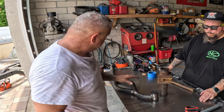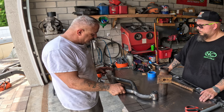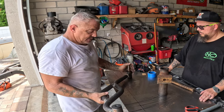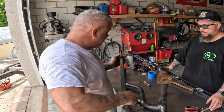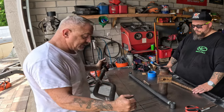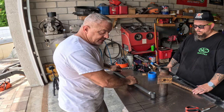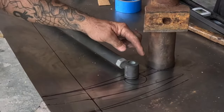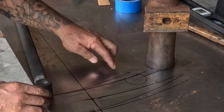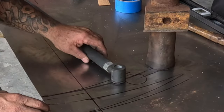We're going to shorten this bar — I want to say four inches, three and a half inches. I'm just going to cut it off here at the very end and re-tap some threads. To give you an idea, this link bar is basically four inches shorter. So we're going to put this to the ground, mount this here, and this would be our new mounting location. Watch the arc when you're raising the car up — it's very minimal. It stays in a much more vertical plane. It's not completely straight, but more straight than the other.